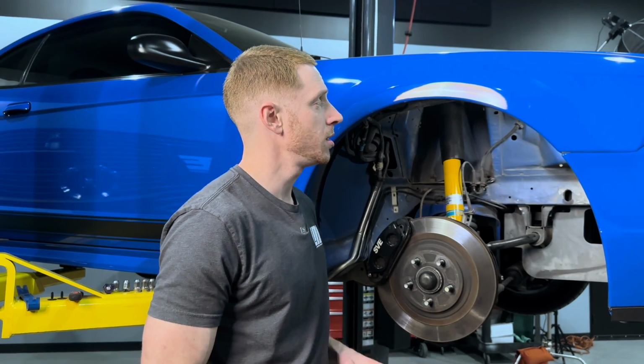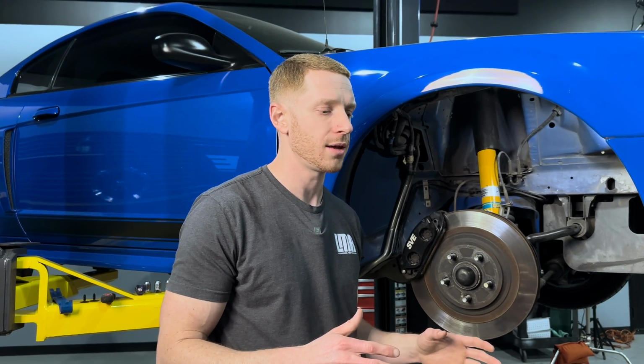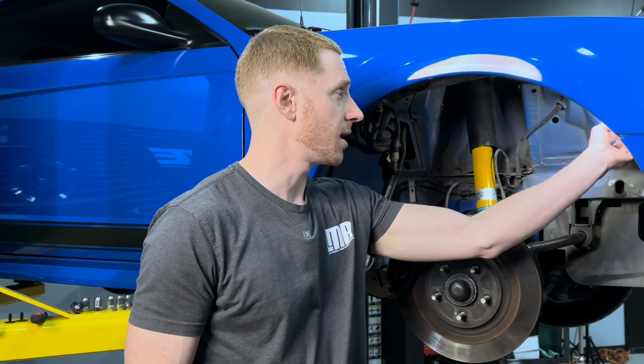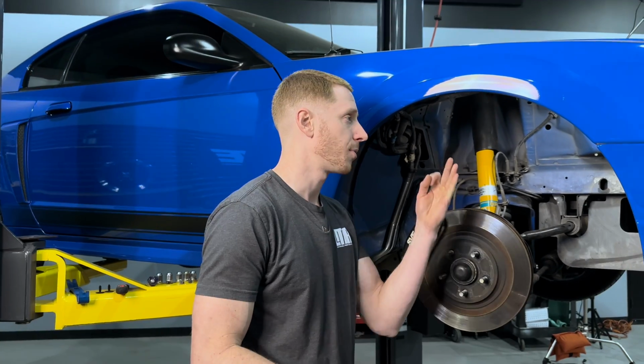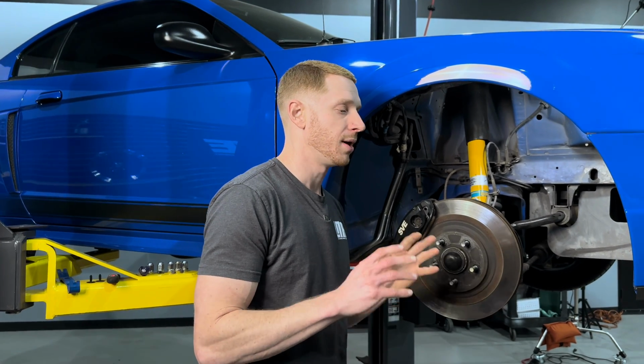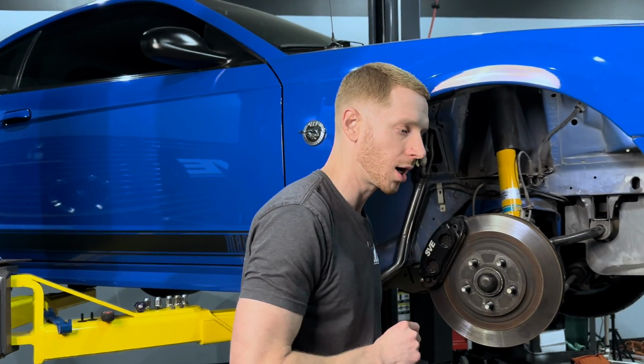If you're doing some troubleshooting and you feel like the fuel pump relay could be a reason why your fuel pump or something related to the fuel pump circuitry isn't working, and you've determined that it is the CCRM, you can replace the CCRM with a good used one. You can have the CCRM rebuilt, or if it's available new, you can purchase a new CCRM. Now, depending on the year range and the engine, will determine whether or not a new CCRM is available for your application. As far as the ones we offer here at LMR.com, I'll leave a link in the video description for you to check those out.